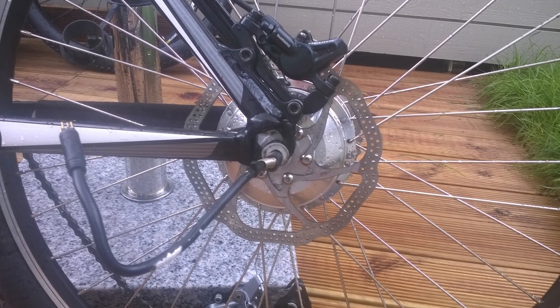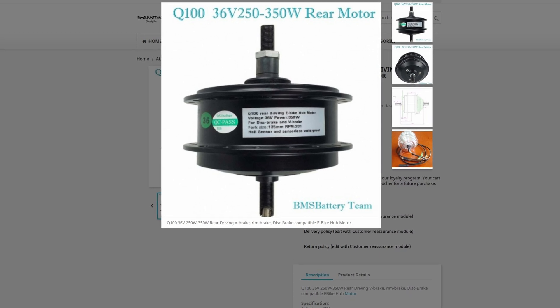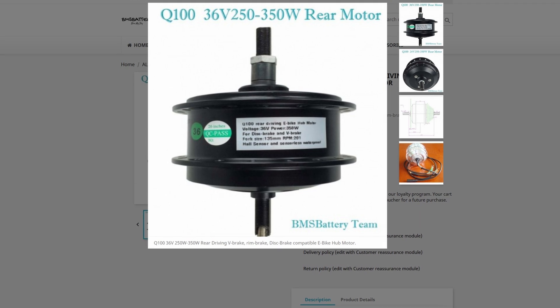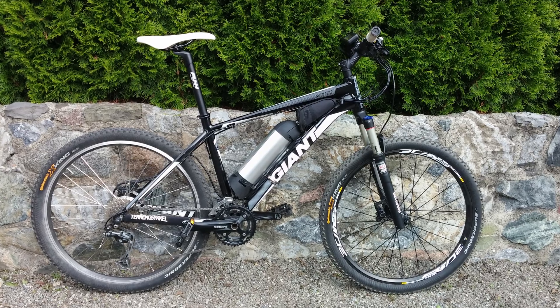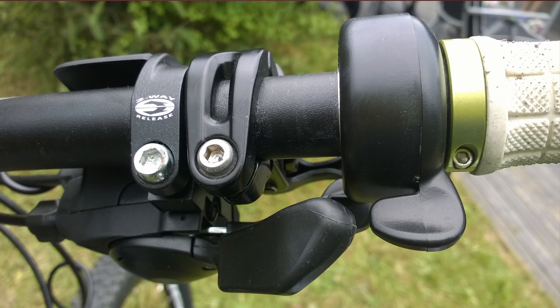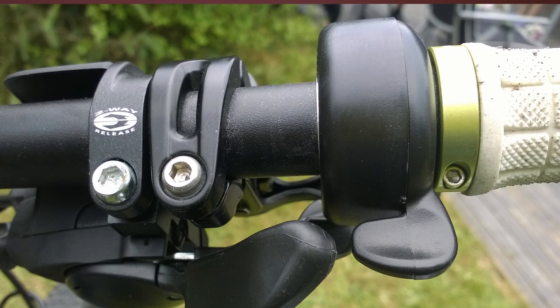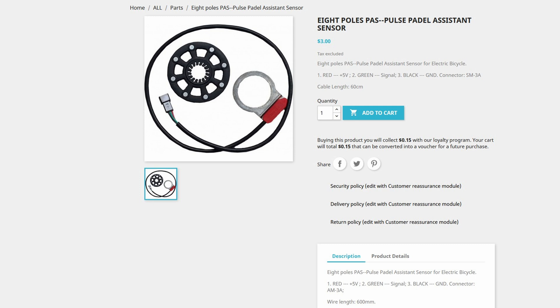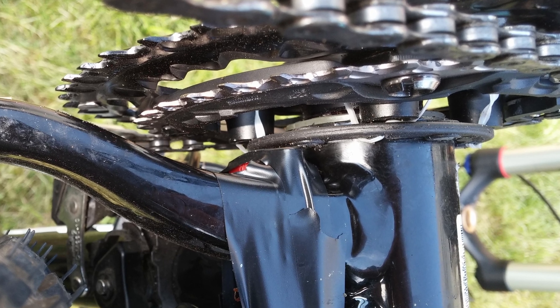There are DIY motors out there that are purely cadence based. My first DIY EMTB used a hub motor — the 201 RPM version that would do 25 kilometers per hour with a 26-inch wheel and 36-volt battery. Just mounting the motor controller, display, and battery on the bike left me with no way to activate the motor. I could install a handlebar thumb throttle, which legally would turn the e-bike into an extremely weak electric moped, or I could install the PAS kit. PAS is short for Pedal Assist Sensor, more typically referred to as a cadence sensor.